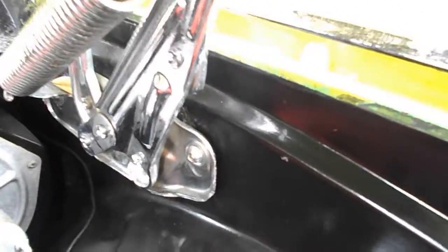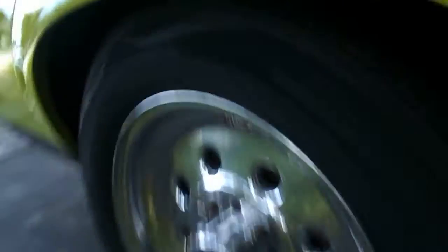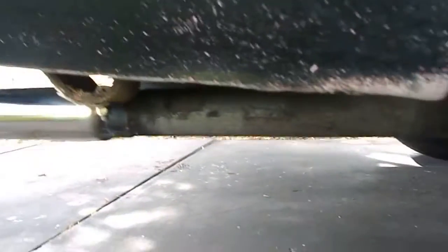The bottom of the doors is going, the seals as well — the usual Torana stuff. But behind these hinges is all fibreglass, which is quite bad. The door itself isn't too bad but I'm getting rust bubbles coming out under the paint. I try and keep this thing under cover in the garage but we live sort of near the ocean so it's copping it. The wheel arch quarters from here don't look too bad — someone has botched them up with other panels at some point.